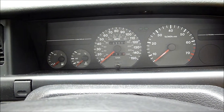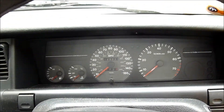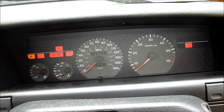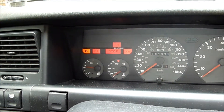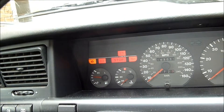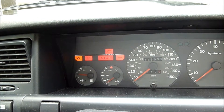And then when you've done that, just go to your dash and you'll get the blink code. So I'll show you that. I'm going to put C2 to ground for five seconds and I'll show you what happens. It's not meant to be a professional video, it's just a home DIY one which can help people. So I'll put the ignition on now — I've put the code in. It's blinked there once, so if you keep an eye on this engine management light we'll see what happens. My car hasn't got a fault at the moment but it'll give you an idea of how to read the codes.